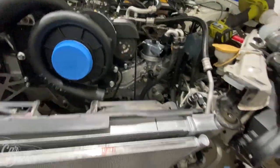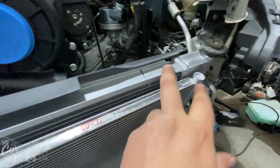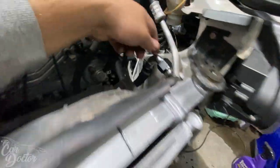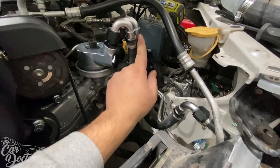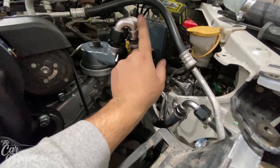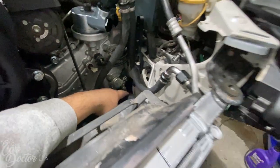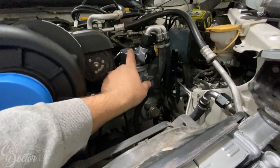And the oil cooler was installed as well. So it's basically the same thing as your typical oil cooler, but it's in the radiator, so it takes up this half. The CSF core is actually a bit shorter, and you have an AN line that goes here, has a little swoop around here, and comes up. Same thing for the bottom one, it hooks up right underneath the radiator hose. So we got those hooked up. All we need now is a filter, and that should be done.